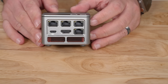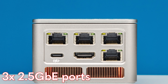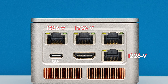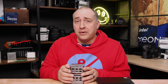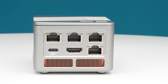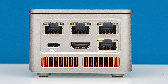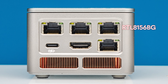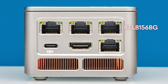Flipping around to the part everybody wants to see — we get three 2.5 gigabit Ethernet ports. These are all Intel i226-V ports, which is pretty standard. But this generation there's something a little different: a fourth 2.5 gigabit Ethernet port, which is a Realtek port — not an Intel port. That Realtek port isn't a standard RTL 8125 or similar; instead it's an RTL 8156BG, which means it's actually a USB 3 NIC embedded in the system to get that fourth NIC.